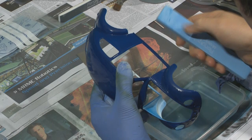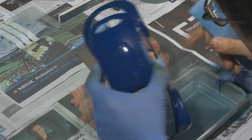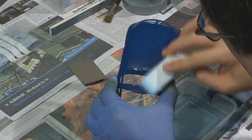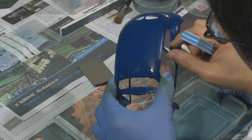Then we're going to come in with the polishing stick. On this particular brand, the blue pad is a little bit heavier grain than the white side. So we're just going to use very gentle circular motions where you can, because otherwise if you just do streaks, worst case you might take the paint down to the primer or even the plastic.